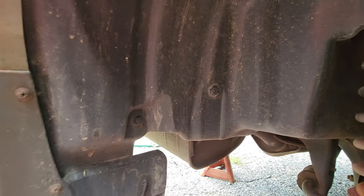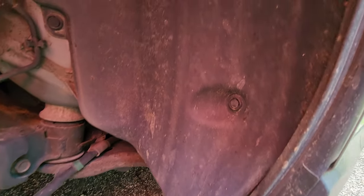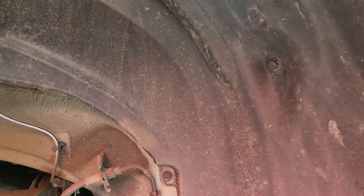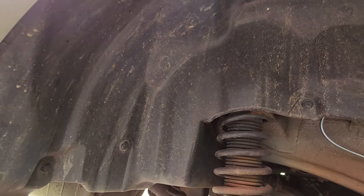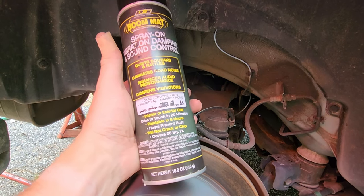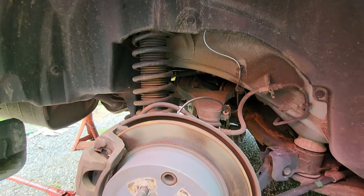There are quite a number of them — I think 11 or 12 total. You'll have to feel around for your individual car and see what it has. There are also screws here and here. I don't believe there is one on the front, but I'll report back on that as soon as I get this off. Basically we're removing this cowling to expose the metal, clean it with rubbing alcohol to break down any grease and oil, spray coat it — it dries to the touch in 20 minutes — and then put the plastics and wheel back on.